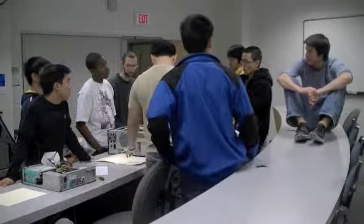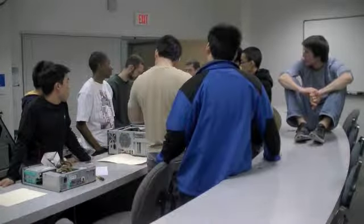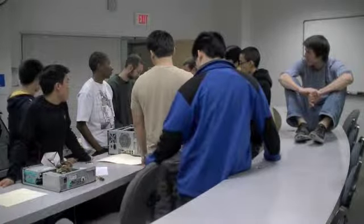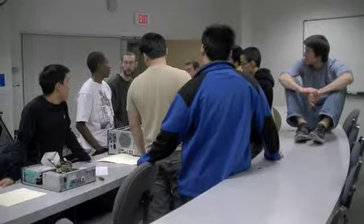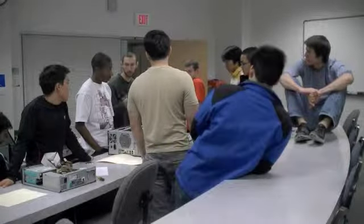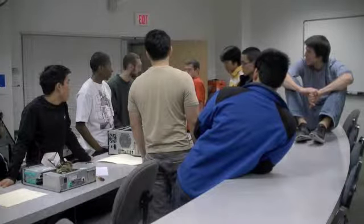It gets a little bit more complicated, but you can usually change settings for that in your motherboard. Obviously the processor is not going to change for front side bus, but you can change the RAM speeds and get certain ratios that are supposed to be faster or slower. You don't really need to worry about it. As long as the parts will work together out of the box, you never have to really swap that stuff. It's more of an overclocking or extreme performance kind of thing.